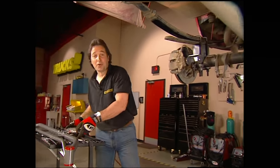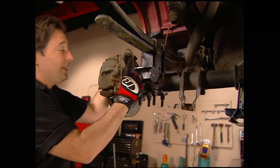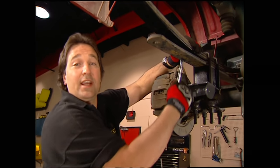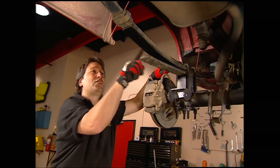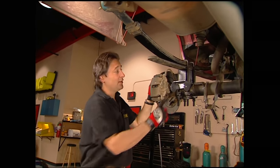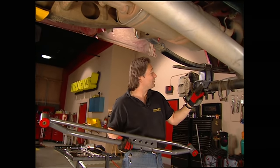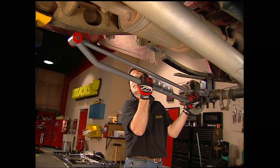Like I said before, the kit gets the majority of its lift by using a four-inch block. But remember, any time you put a taller block between the spring and the axle, it's just like using a longer-handled wrench to get more torque on a bolt — except in this case, all that torque goes up into that leaf spring when you hit the gas. That gives you axle wrap. The taller the block, the more axle wrap is a problem. The kit fixes that with these traction bars — the bracket goes right between the block and the axle and will totally fix that problem.